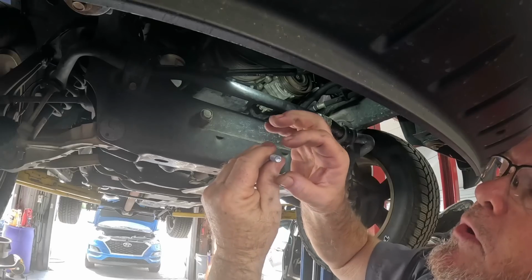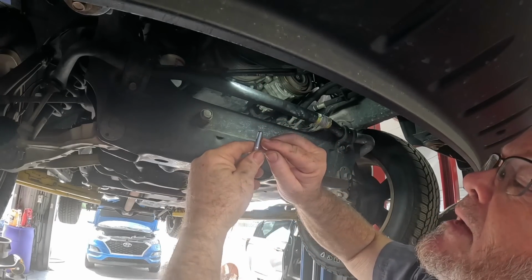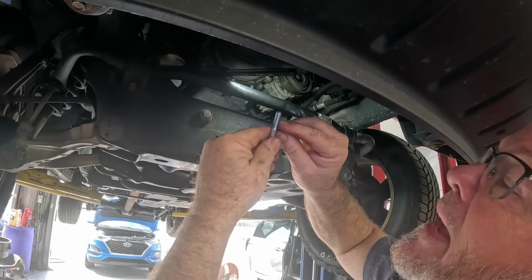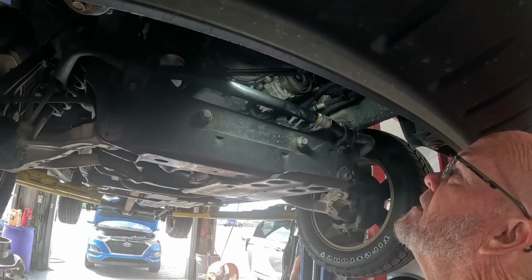As a rule of thumb, whatever the diameter of the bolt is, that's at least how many threads you want to grab or more. That's the bare minimum, it would be about that many. I wouldn't feel comfortable with that. We're about 2 threads past that. I think that's going to be okay. And honestly, it's all we can find for now. We don't have a lot of options.